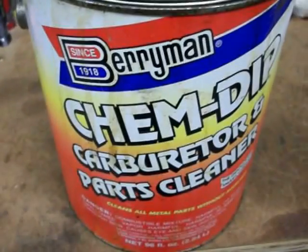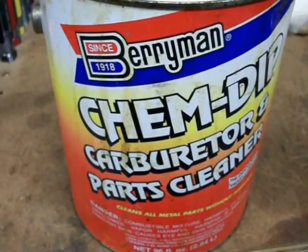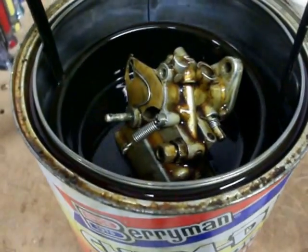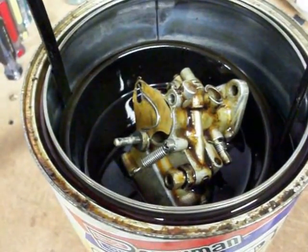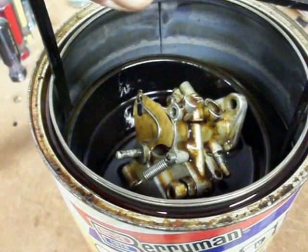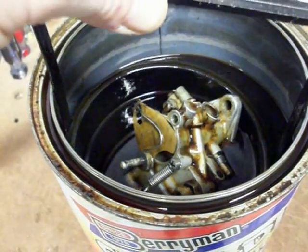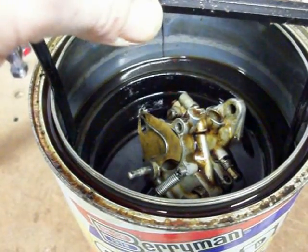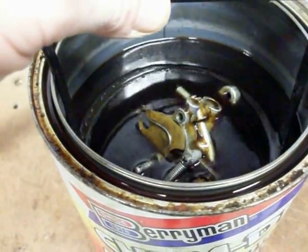This is the other half of our carb cleaning process — actually the first part. You can see I've got the carburetor body in there and it's already starting to break that gunk down a little bit. We're going to let it soak for about 20 minutes and give it a look. I didn't want to put the top piece of the carb in there with the needle and seat because this stuff will tear that up. You've got a better chance using the ultrasonic cleaner — it doesn't seem to damage it as bad. So we're going to put this back in and let it soak for a while.